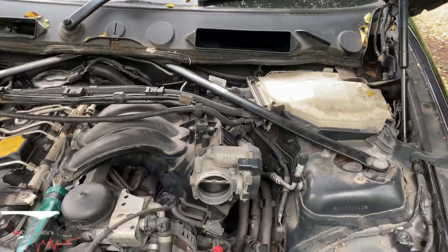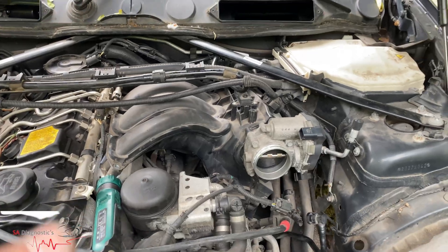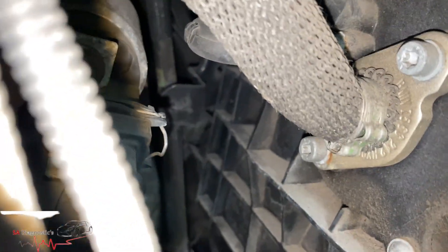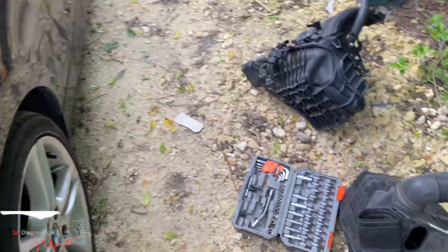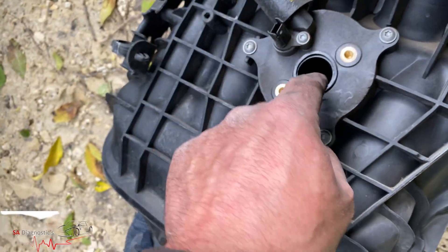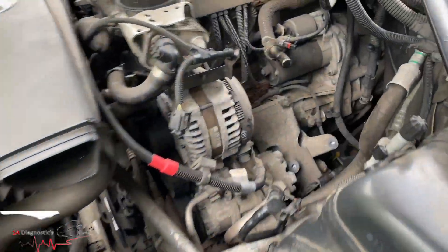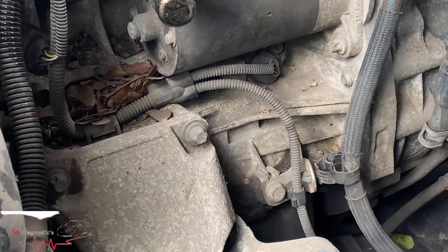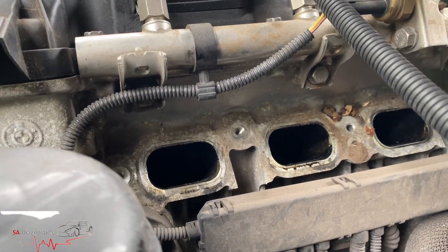It's really hard to lift this up. I thought something else might be holding it, but it's not. There's another bolt on the other side which I need to get to — once that's off it should be a bit looser. After about 40 minutes, everything is off. Don't forget to take that sensor off without breaking it, and make sure you don't mess up the washer. Undo those two screws and — finally — there's the crankshaft sensor. It's a ball ache, but we got to it.